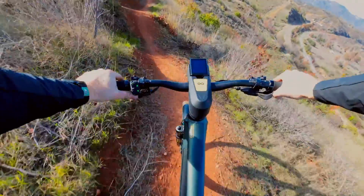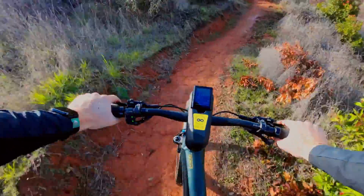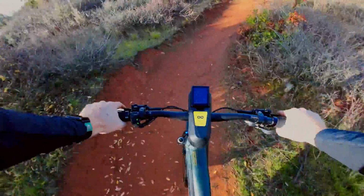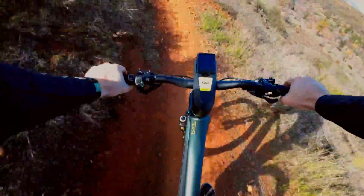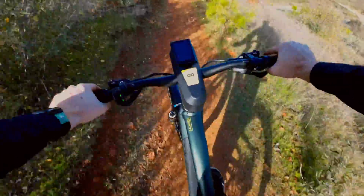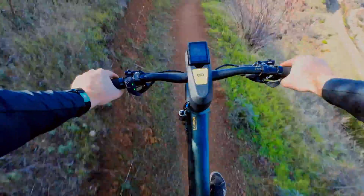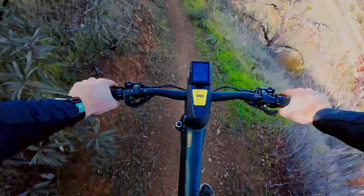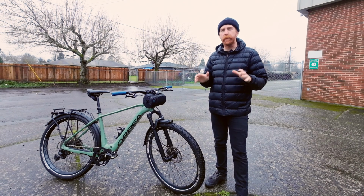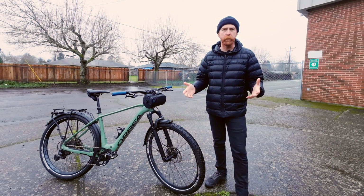Equally, with these Allgrounders, even though in a clip like this I am riding on the dirt and having a great experience, I'm having good traction, when it comes to braking and stopping, the pads or lugs on these tires are closer. They're gonna have less conformity to that rougher terrain, where the Johnny Watts, having wider separation, are gonna let those rocks and pebbles get in between the tire to really help it adapt and conform to that rougher terrain. So when it comes to tread design and tread pattern, these two tires really are great examples of tires that fall under the same category, but have their benefits in different types of riding.